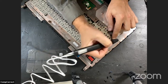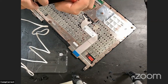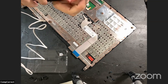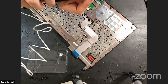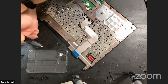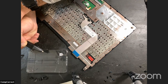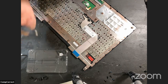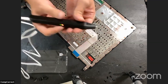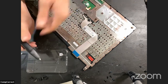It's not feeding. Is it hot up? Is it hot? No. Your green lead's not there, is it? Have I managed to plug the tip already? No. Come on, it's easy. What's your lead doing? All right, so you're up to temperature if it's solid green. So you reckon you might have a jam already? Yeah, a cloggage, possibly.